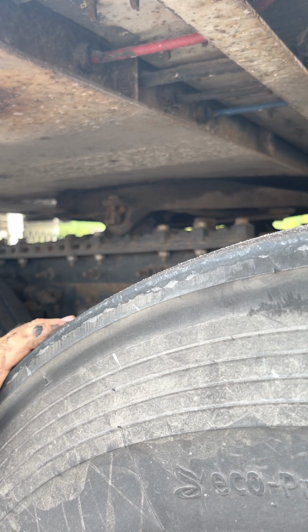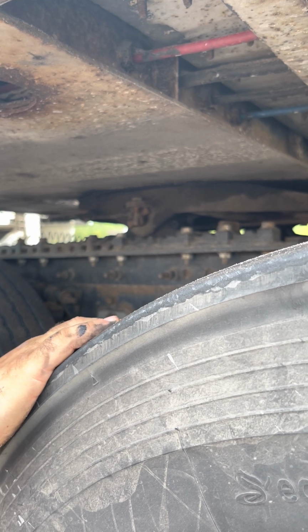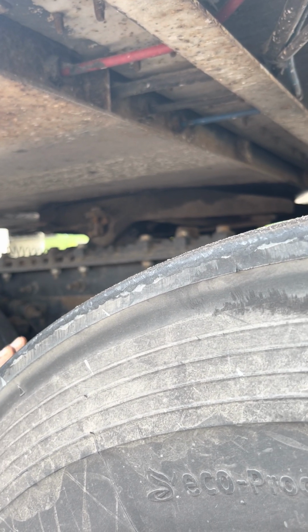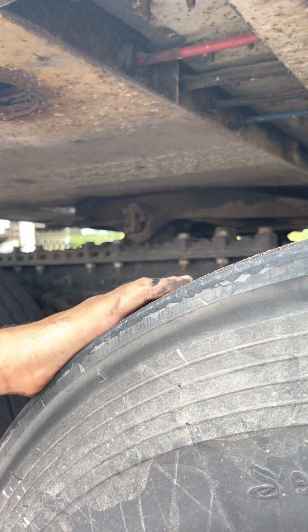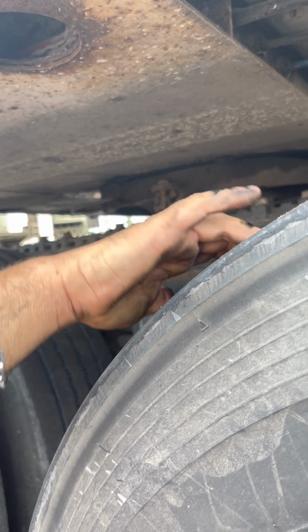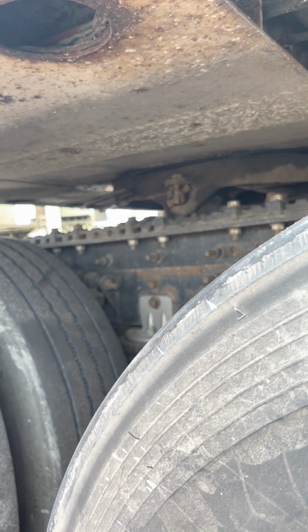You wanna make sure there's no gap between the apron plate and the fifth wheel plate. That's a part on its own, is mentioned in the gap. As long as there's no gap, we're good. All right? Next would be the fifth wheel plate itself. All right, it's properly mounted, it's not cracked or broken, and it's properly greased. Keep working down, fifth wheel release arm next, okay?